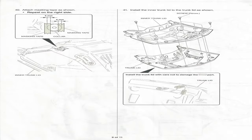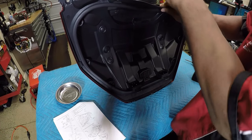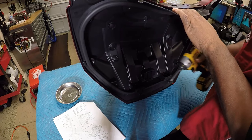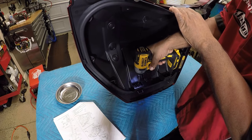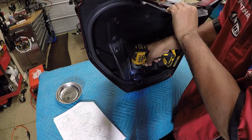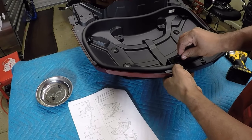Now that I have changed out the damper struts on the trunk and reinstalled the trunk panels, we can get into the disassembling of the trunk lid. Let's get the striker rods taken out of the trunk liner — we have four Phillips screws. Looking at the illustration, it shows you the bend of the striker rods, so pay close attention to how the striker rods are oriented.